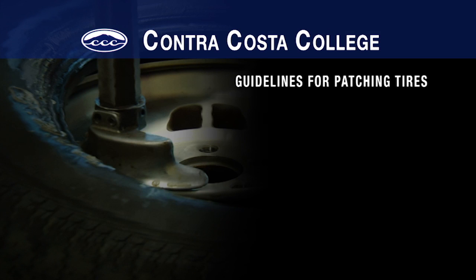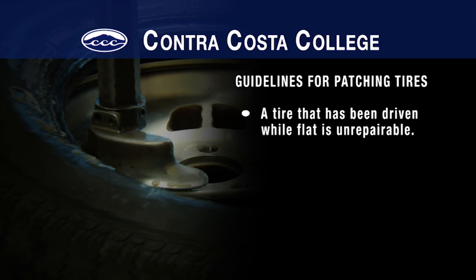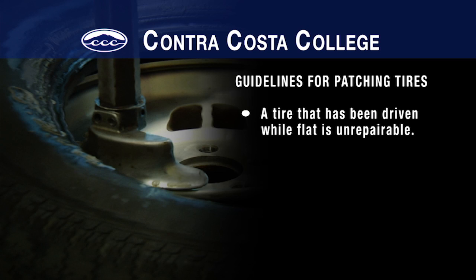Finally, we must check if the car was driven on the damaged tire after air pressure was lost. Look for a ring-shaped groove on the sidewalls before starting the process of patching the tire. When a car is driven on a tire with very low air pressure, the rim cuts into the sidewall, making ring-shaped grooves. Thin damaged sidewalls can cause a tire to blow out without warning.